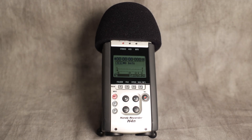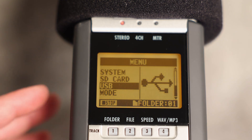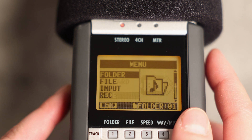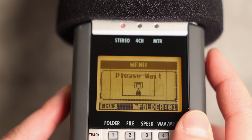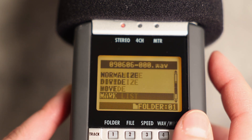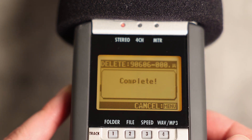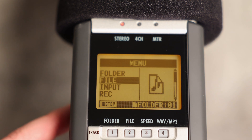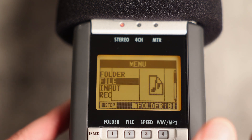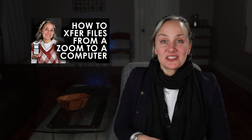Your settings are set. Before you record, you should start with a clean SD card — it should say No Data here. If it doesn't, you can delete the files on your card in the menu settings. Use the wheel to scroll down to File and push the wheel to select it. Scroll down to Delete all the way at the bottom. When it asks if you're sure, scroll up to Yes and press the wheel in. It'll then say Complete. Hit Menu again to get out of the menu screens. Or you can also delete or backup your files to a computer or hard drive. I have linked my how-to transfer files from a zoom recorder video in the description.